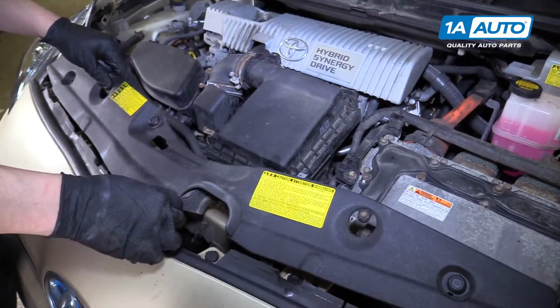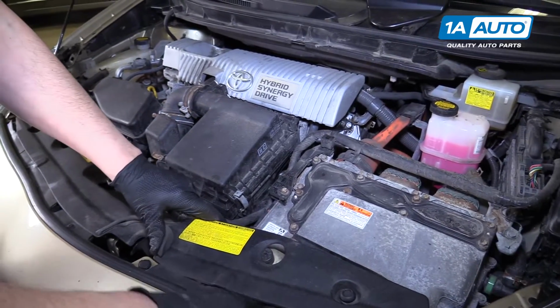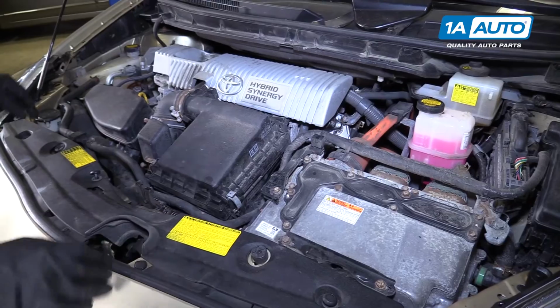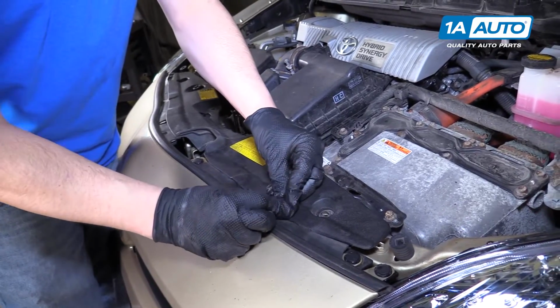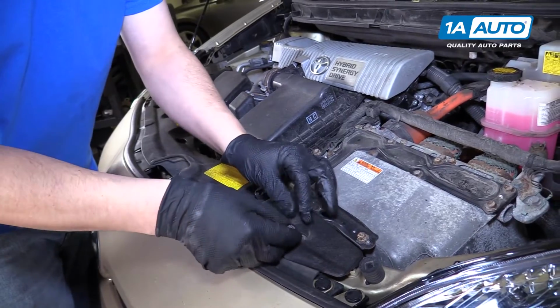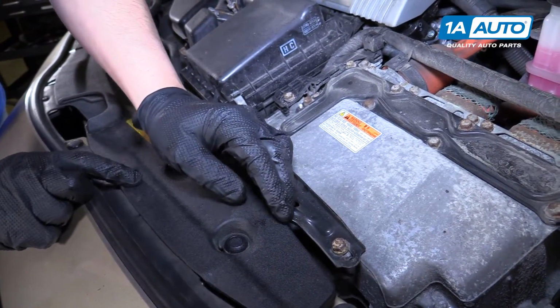Lay this piece back where it was. It's over this rubber gasket. Line it up. Push your trim clips out. Might help to have something hard to push against. You want them to be like that. Feed those in. Reinstall the 3 trim clips on the top.